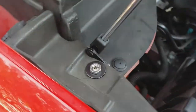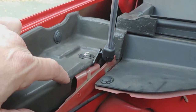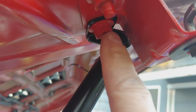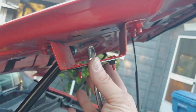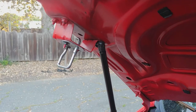Took pictures of the part numbers. The brackets point towards the back firewall side of the car on the bottom, and towards the hood front of the car on the top. They use the nut from the hood latch mechanism. These originally have a plastic cover on them — took those off; they're just held on with plastic nuts, two screws, and they come right off.